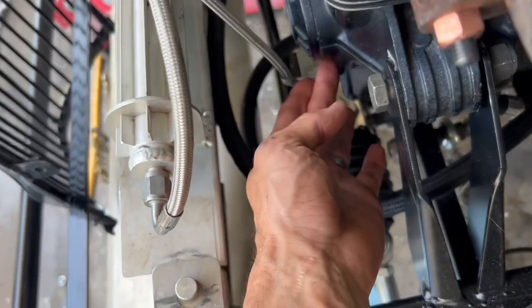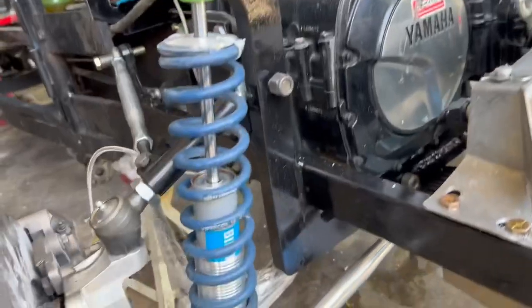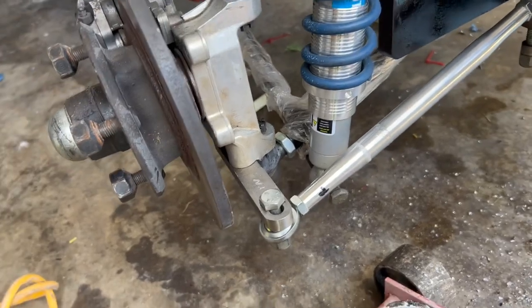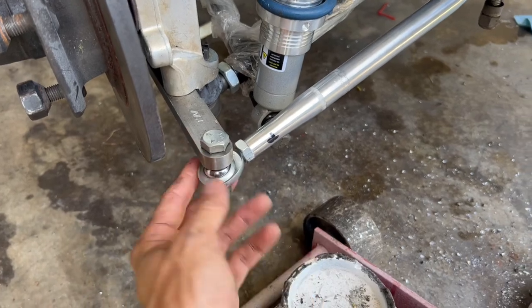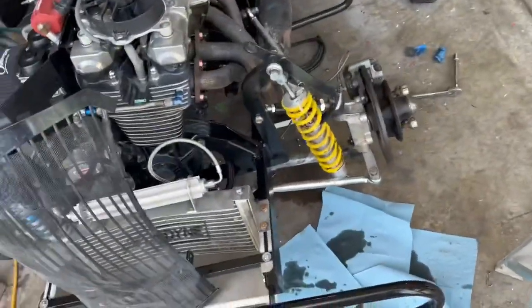All right, and then of course your out of your right tube, that one goes down to the front lower part of the motor. Left side of the tube comes up and splits into your heads. Okay, some things to note that I'm not for sure if I covered quite exactly right or not. Your 12-inch bars on your front right, your swedge tube and your heim goes below your steering arm there, and it goes on top of your steering box. So it goes top to below on that one, on both sides, on your 11-inch bar and your 12-inch bar.